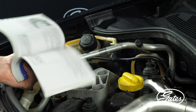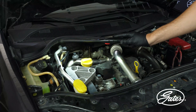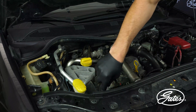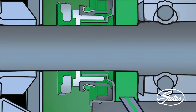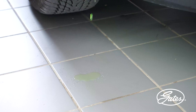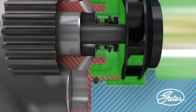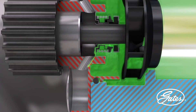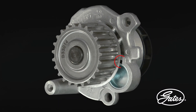Let the engine run for a few minutes and carry out an external check for leaks. During the running phase, a slight leakage of coolant with a few drops on the ground is acceptable. This means that the film in the mechanical seal has not yet formed and that the liquid is escaping through the weep hole. However, this should stop quickly. Continuous leakage is not normal. If the water pump is equipped with a weep chamber, the flow will be collected there. There is a small hole in the cap that allows the liquid to evaporate on contact with the air.